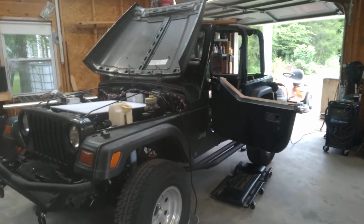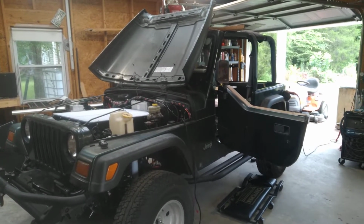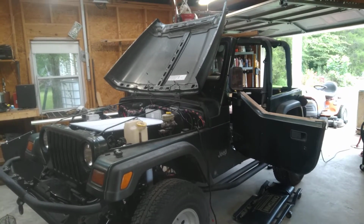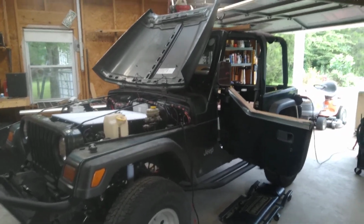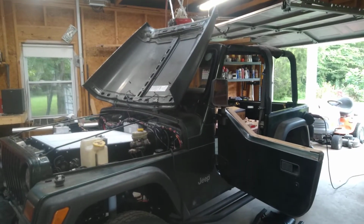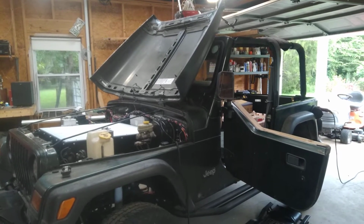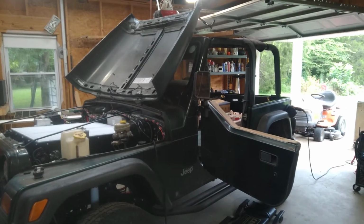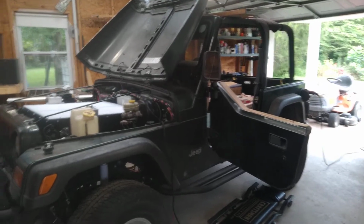Got a pretty exciting weekend. I think last time we talked, I got all my high voltage cabling completed and wired up. And I had what I was hoping was all my BMS wires connected. I contacted Orion BMS and they sent me their cell tap monitor, or cell tap checker. What you do there is you connect the wires that go into the BMS, take that connector and plug it into this cell tap thing, and it goes through and makes sure that you wired everything correctly. And I hadn't.